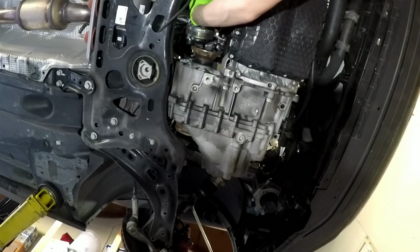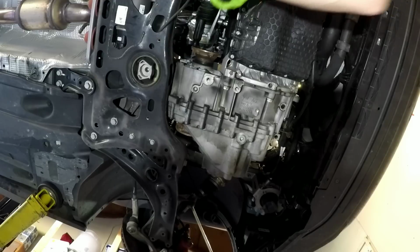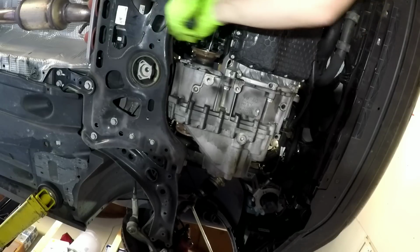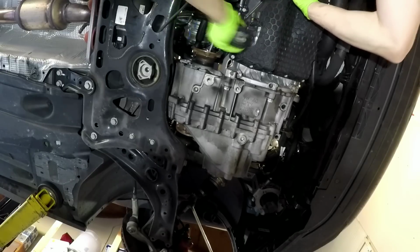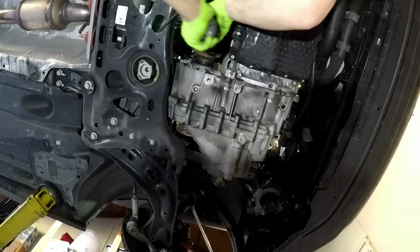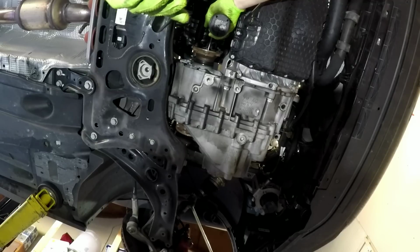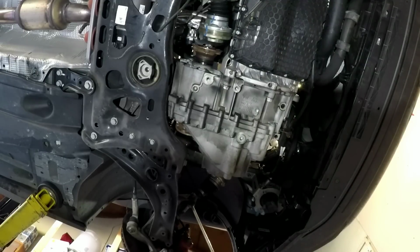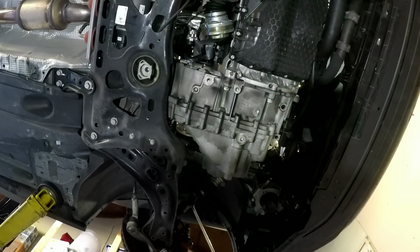So actually what I like to do is push this axle up, stick the screwdriver in there. The axle will hold that out of the way. You can go down the middle, right here. See the screwdriver hit, and then you just break this middle bolt loose. Somehow. So then if you push on the hub part until you can get this out, and you have to take this out. And same thing with the other one.